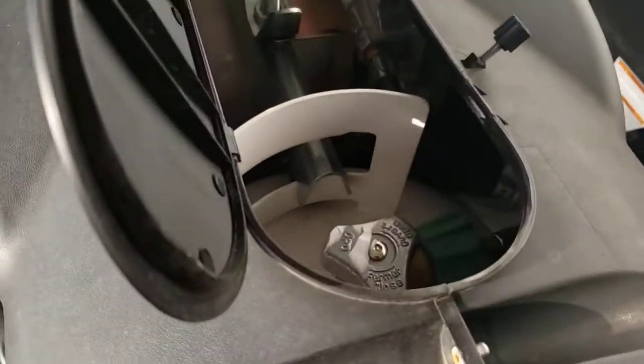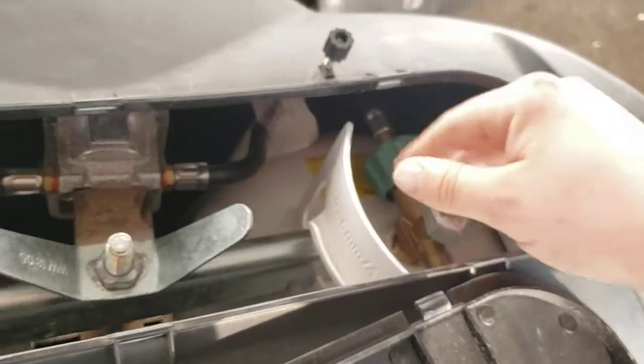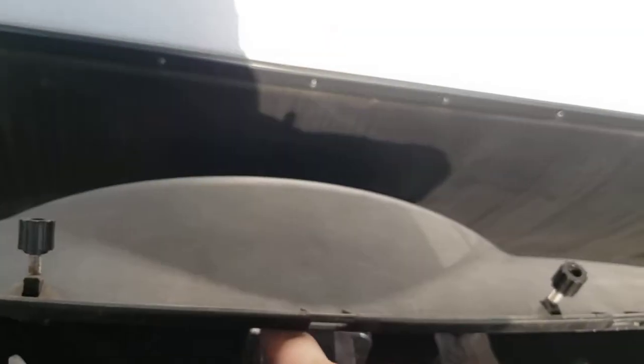Dual 20-pound propane cylinders — they're all full, so you don't have to worry about getting them filled. There's a little black valve selector in there. Whichever direction it's pointing, that's the tank it's pulling from first. When that tank empties, it'll automatically switch to pulling from the second tank; however, that little black bar won't rotate to indicate it's switched. Keep that in mind. Some people put it in the middle thinking it'll pull from both tanks equally — it doesn't work that way. It's one or the other.